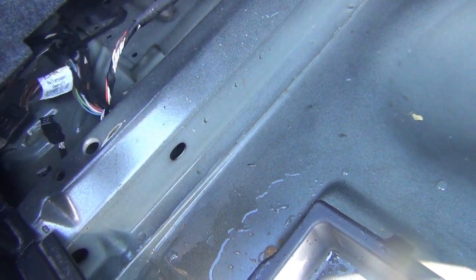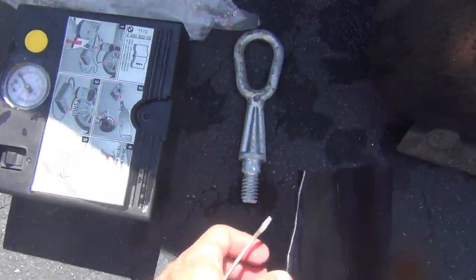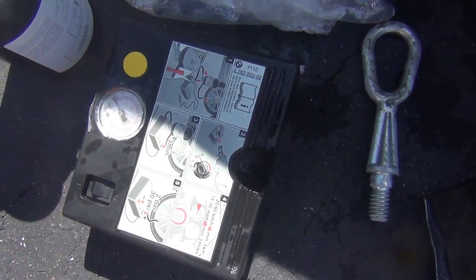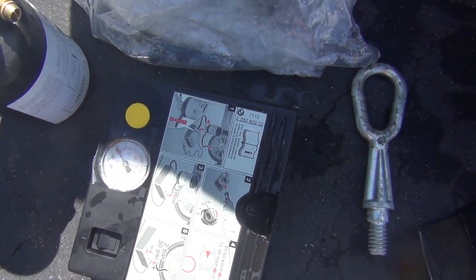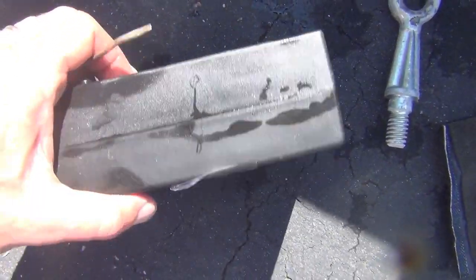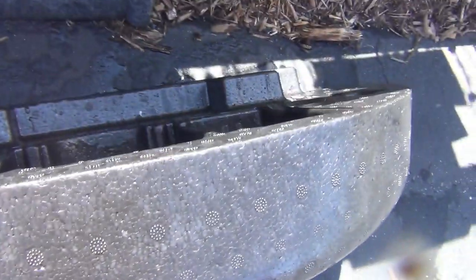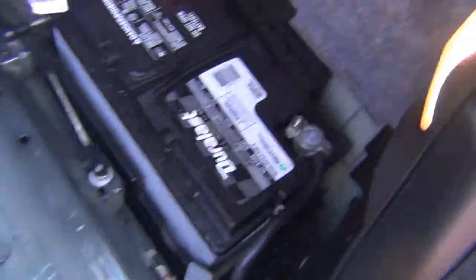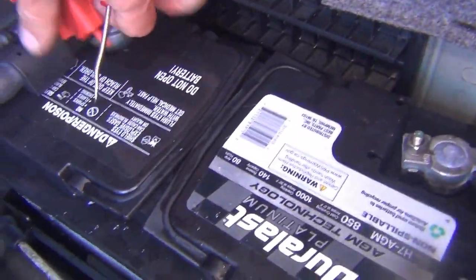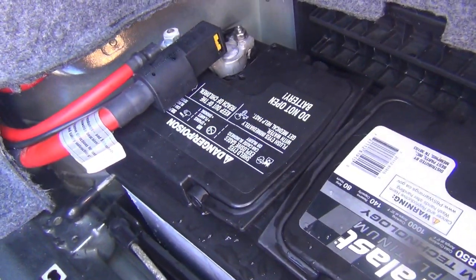You can let this sit out to dry. This is an M car, so the entire inflation system was basically underwater — I don't think it's going to work anymore. There was a relay in the back — a rusted relay. That's no good. I pulled the panels out because they were soaking wet. I'm going to pull the battery out, and there's a metal tray that this battery sits in, which is kind of a pain — it has these ball joints that you have to pop out.